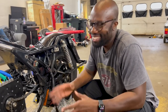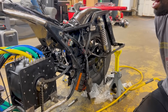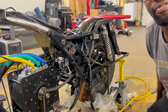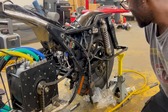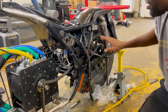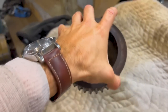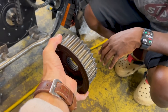Just kidding. The person that brought it up, it is a good idea. Having a belt drive instead of the chain drive will make it a very, very stealth bike. We'll probably get killed a lot faster because no one is going to hear us coming at all. And with the belt drive, with the sprockets, it's a lot more difficult to get the adjustability front and rear. For example, on this bike there's only one size rear sprocket, and for the front there's really only one or two size sprockets. Your adjustability is very limited, and this is all for the sake of being quiet.